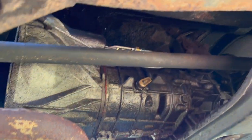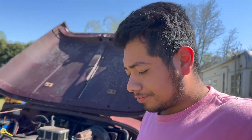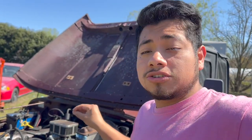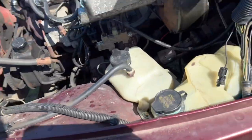So before I couldn't double-clutch at all even when warm. Now when it's warm I can double-clutch no problem, but when it's cold I have to skip second gear completely — go first to third until the transmission warms up. Once warm, I can double-clutch into second beautifully. The mod definitely helped; my transmission is just old and crappy, so I want to give that heads-up since I had said this fixed my second gear problem — it really didn't completely fix it.